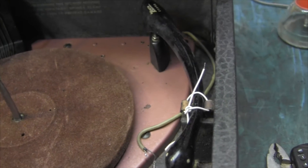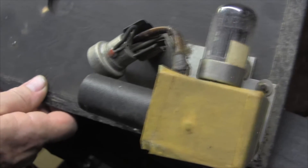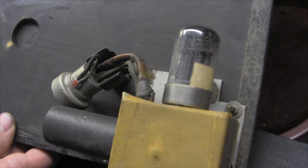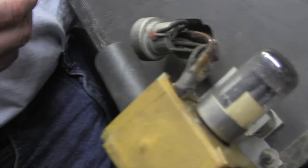The prior model had a tubular tone arm with a black headshell about the size of a domino with a crystal cartridge in it. This was the upgrade with the Cobra. Notice this little pin box — that's where they put the Cobra adapter unit. The cover goes on from the bottom. The Cobra cartridge adapter is a combination oscillator/demodulator that takes the FM frequency off the cartridge and turns it into audio. They used this to upgrade existing systems for a number of years.